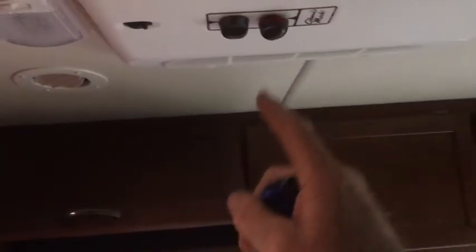And I fished a piece of baling wire from the cabinet this way, and I'm sorry, from this way to the cabinet, hooked the wire on and pulled it back, so I only had to pull that little short distance. That was hard, extremely hard. I used 10 gauge wire, which is overkill. Air conditioning only requires 15 amps. Smaller wire would have helped.